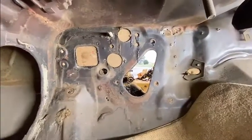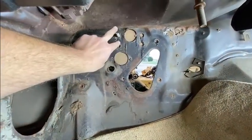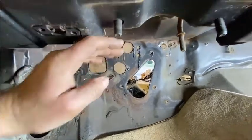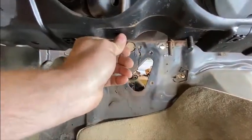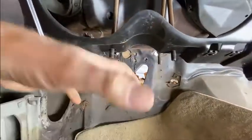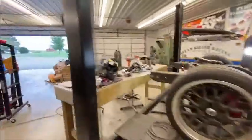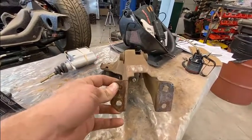If you go into the inside there's no support. Originally on a 68 Camaro there are four bolts that hold it, and then a big chunk of metal comes up as a shield and attaches to points right there and here, holding everything together nicely. When you push on the pedal it actually pulls on these, which helps keep that firewall from flexing. That's ultimately what we're after - no flex.